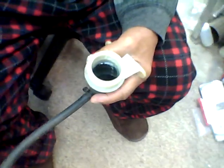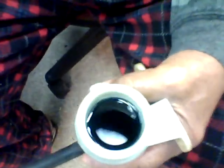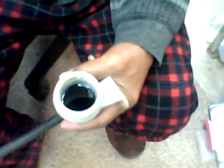I'm doing this because I'm getting bubbles. Hopefully you can see the little bubbles. They just keep getting generated, so it must have a leaking seal in the slave cylinder — that's my guess.